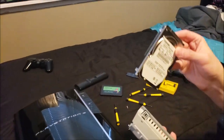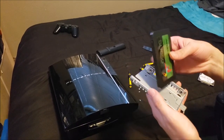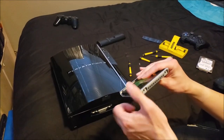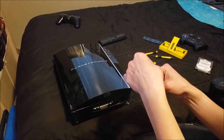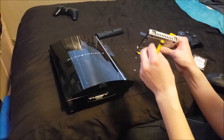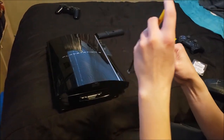Here's our old drive — it's a Toshiba. Toshibas, the laptops are terrible, and they were slow. So now you want to take your old drive here, and connect it — it should slide all the way back in there like that. Then we want to put our four screws back in. This is where I wish I had a magnetic screwdriver, because it basically holds the screw in place when you're trying to screw it into the drive.